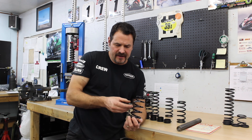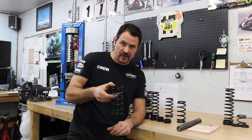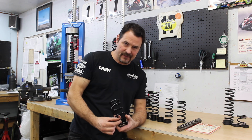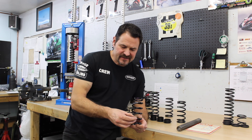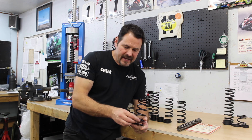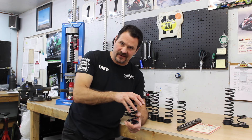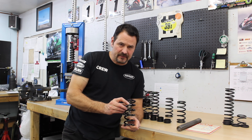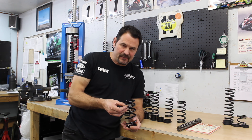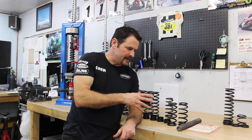To continue along that vein of thought, if I take this 4.0 spring and cut it in half, I will now own two short 8.0 springs. The rate of a spring is determined by the diameter of the wire. As the diameter gets thicker, the rate goes up — the stiffness, the effort to deflect it, goes up. We pick a diameter of wire and wind it around the shock body for a certain length, and those two parameters give us the rate. In this 152mm long spring — a 6-inch spring — we can have all different rates with slightly different wire diameters. We have tremendous flexibility when selecting our springs.